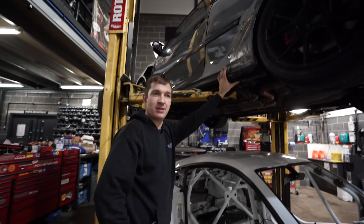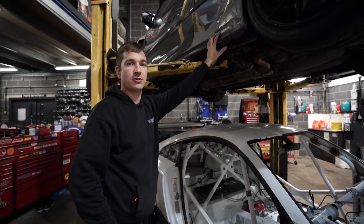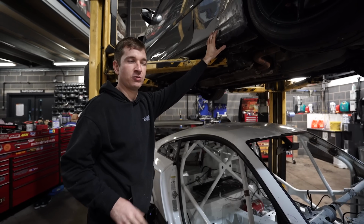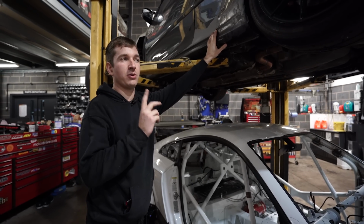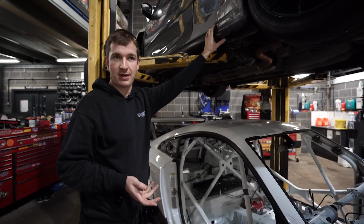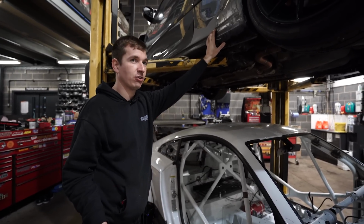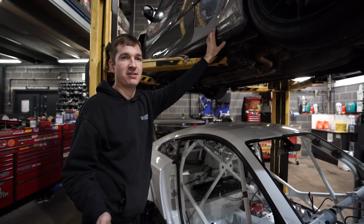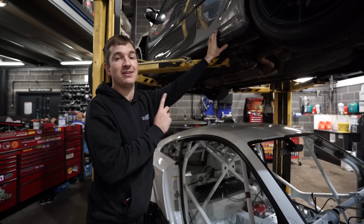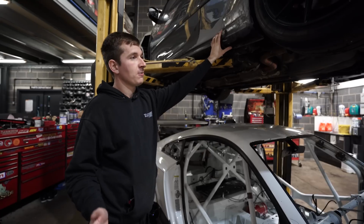So the idea is, with the Golf, looks a mess at the minute, not really easy to get to, but I think we're going to swap the ECU for a transporter ECU, and that'll allow us to put piezo injectors in. The transporter ECU is very similar architecture to the ECU that we run at the minute, so we can transfer a lot of stuff over to that, and then we can run the piezo injectors, which I'm hoping give us maybe 30 horsepower more for the same EGTs, AFR and stuff like that, and we're going to put the cylinder pressure on as well, with the bigger piezo injectors.